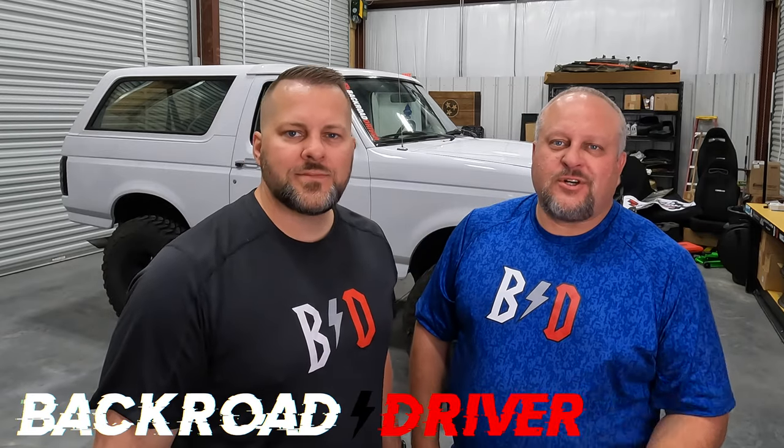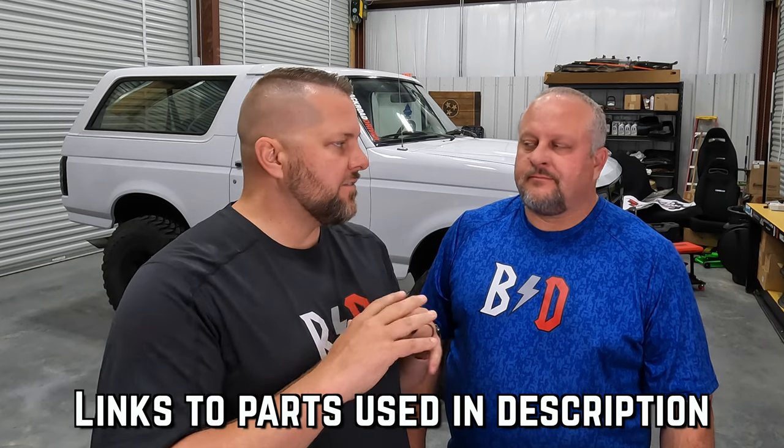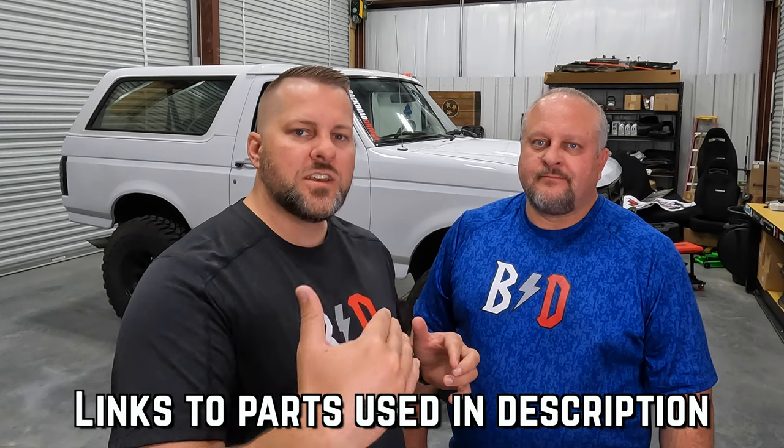Welcome back to Back Road Driver, we're the Miser Brothers. This is build video number six on our 1996 Bronco, 'The Juice.' We're about to change the back glass out. Most Broncos that have sat outside from this period — and definitely ones from before — have a seal on the back that breaks down, causing scratches in the glass which makes it harder to go up and down, which then ruins the back glass motor. We're going to change that out today and show you how it works start to finish, and we're also going to change out all the rubber seals. I think I'm even getting exhaust coming up through my crappy seals back there, so everything's going to get freshened up.